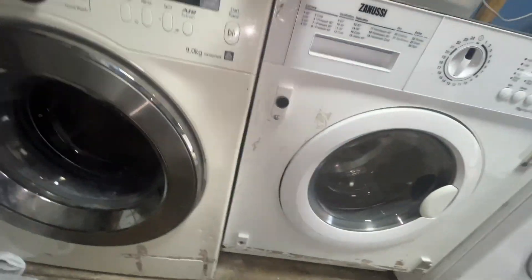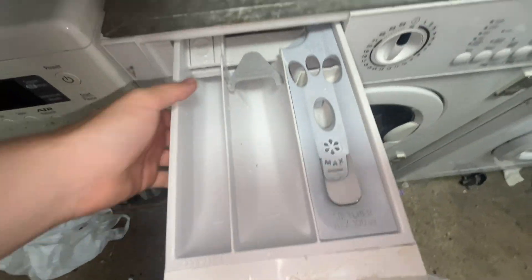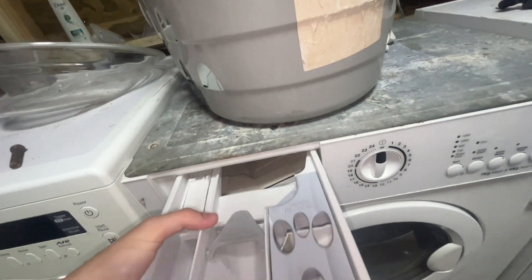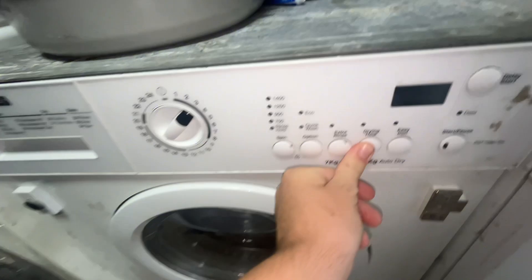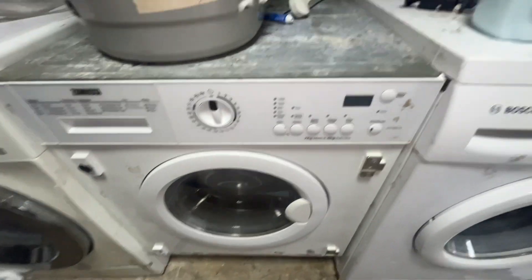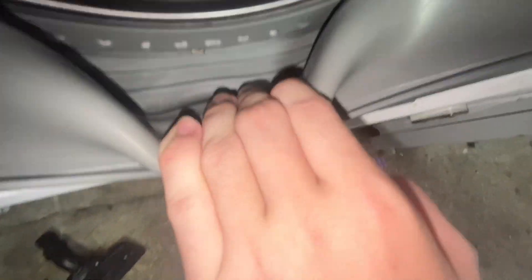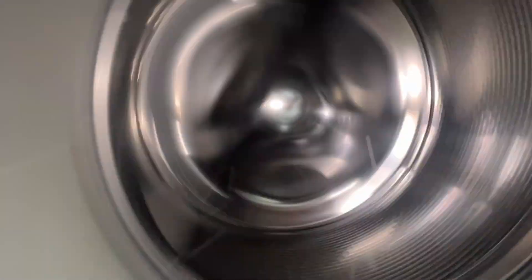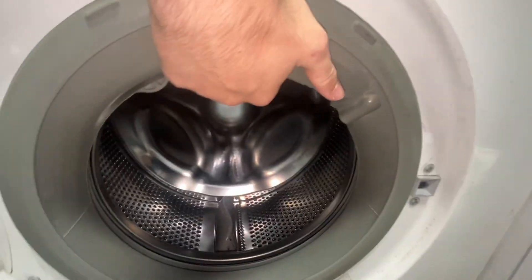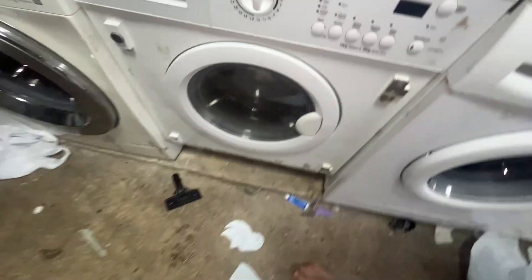This machine is quite famous for tripping the RCD. Inside it's relatively clean, not too bad. This machine spent ages and ages with a non-working dryer unit but it's working now. The door's not scaled that much. The door seal is quite dry because the machine recently ran a drying cycle. The drum's got a bit of scale. Unfortunately the bearings are a bit rumbling — no play though. The spider's fine.